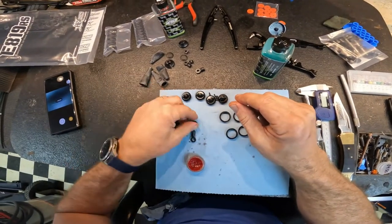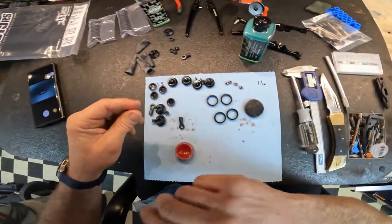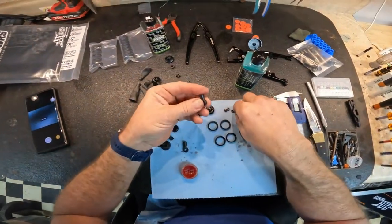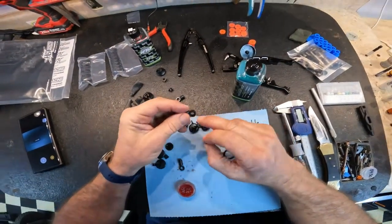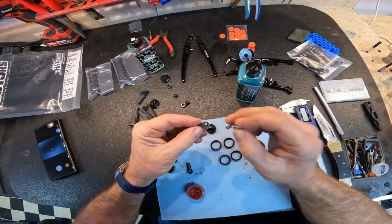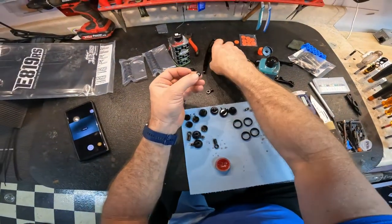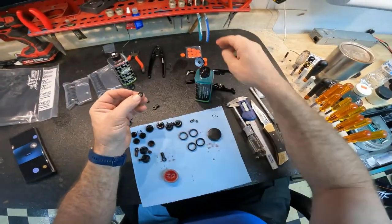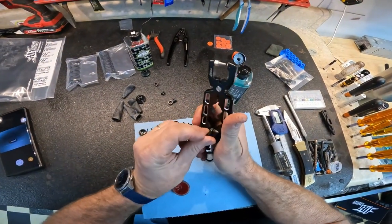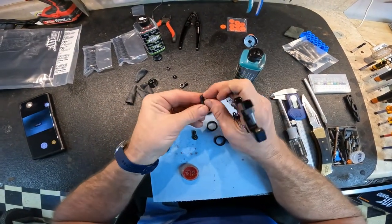I guess we can go ahead and do this prep work. While we're at it, we set our bladders out of the way. Take our shock ends and put them in. If you see, there's a shiny side and a dull side on all these shock ends. Same thing on the end links and everything. Always put it through the shiny side. It goes in a little easier and doesn't warp the piece as much. Use my handy HB tool again, just snap it in place. Again, through the shiny side.